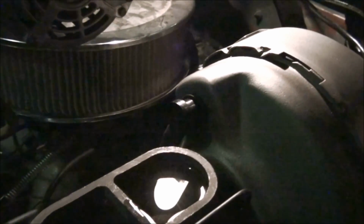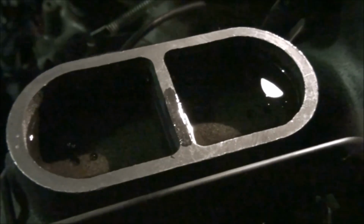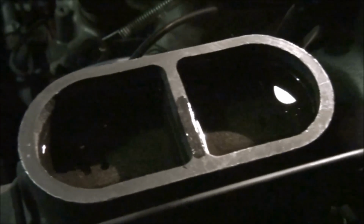So hang on. Okay, I know it's going to be hard to hear me over that thing, and I know this is probably going to be shaky, and I'm hoping I'm even at the darn master cylinder, because I'm going to have to do it by hand. See the fluid coming up? You can see the air coming up. It'll eventually bleed itself until it quits seeing air. And they say when you bleed these things not to use power assist to do it, but a one-man deal, what do you do? You have to use power assist.